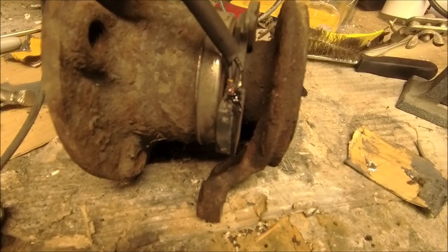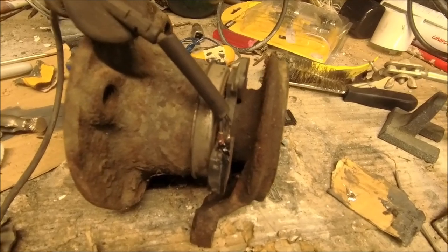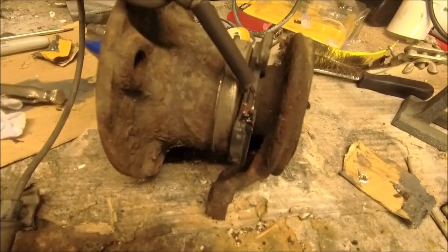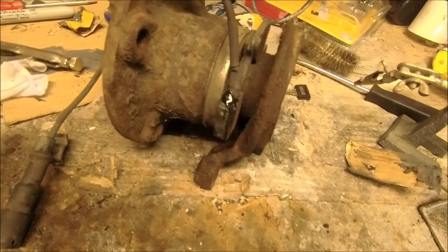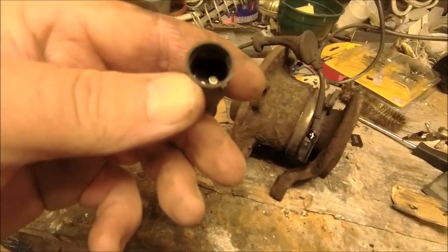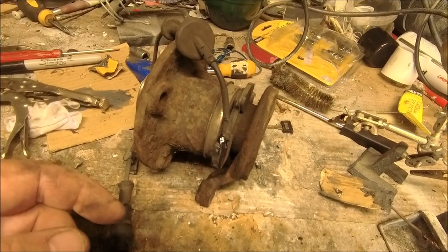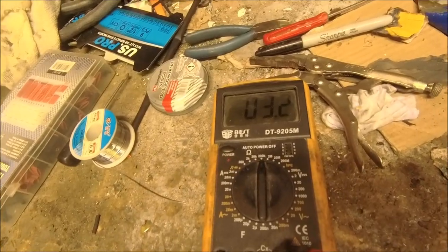I've just got to make sure there's plenty of gap between them, make sure the wires aren't touching, and first test continuity then stick it back on the car. I'm going to have to take it back off again at some point because the rear dust covers haven't arrived - delayed till next week. There's plenty of electrical tape and liquid electrical tape inside to stop anything touching and getting shorted out. Now my theory: if I put a probe on each wire and spin the hub, I should get some sort of alternating signal. Let's try it - and that is what I'm getting! An alternating signal.